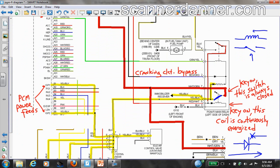There are a lot of cars that don't use this relay approach. What they do is run the ignition switch directly into the circuit. If you're going to do that, the wires going to the ignition switch and the ignition switch itself have to be heavier duty. Which one's better is not the point — it's just different, and you need to be aware of it when troubleshooting.